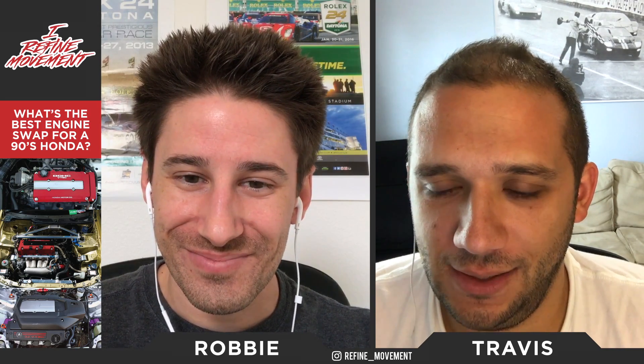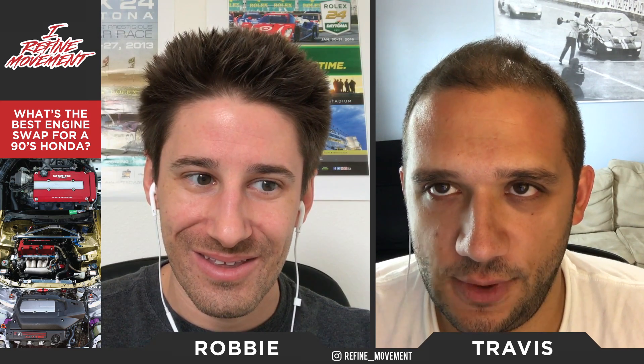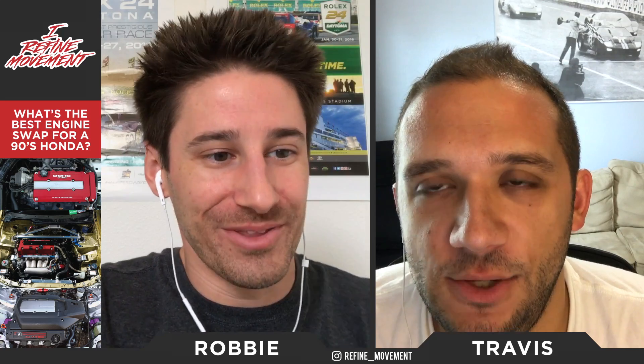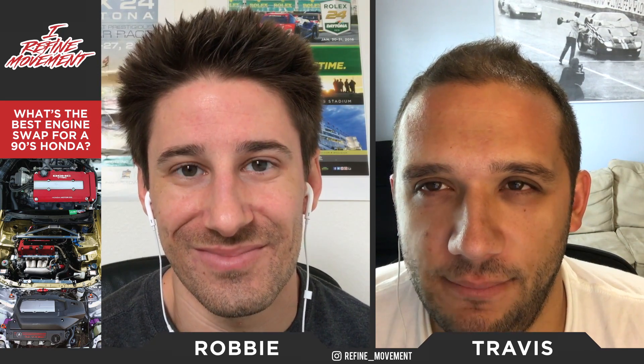The transmission on the D-series might not be best for the street because of the really long gears. The D16 Z6 came out of the Del Sol. We don't have these versions in the US, so they're less familiar to us. The D15 Z6 was the VTEC version — the more powerful D-series of that time. The transmission is definitely the weakest link of that engine. You're low on power, so you need something to make up for that quick jump off the line.